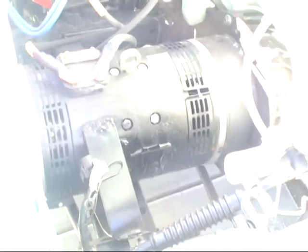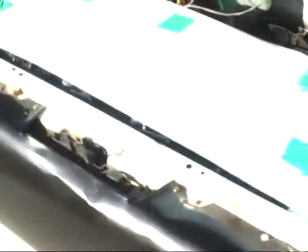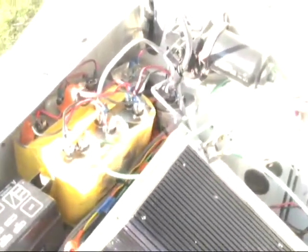Under the hood we have the big old motor — a 27 horsepower DC motor — and a Curtis speed controller mounted on a big block of aluminum. In this foam is four more batteries and a battery charger, a capacitor bank, and a little bridge rectifier. That can plug into 240 volts AC and charge my batteries in about five to seven hours. And under here there's a little computer power supply that runs all my 12-volt accessories.